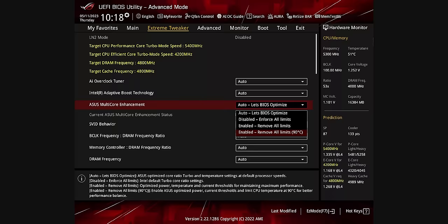Next up, if you've got a beefy enough cooler, some BIOS versions let you toggle a setting like Core Enhancement or Precision Boost Enhancement. This can help eke a little more performance out at the cost of additional heat and power draw by making your CPU turbo more aggressively or for longer. This one is less likely to harm stability, but if you experience problems, I'd recommend just turning it off.